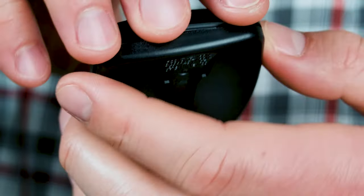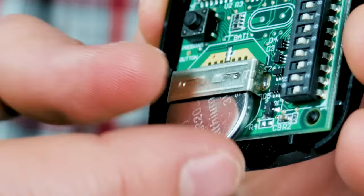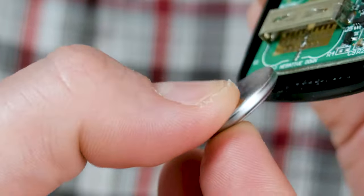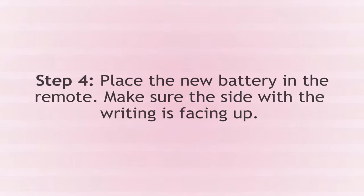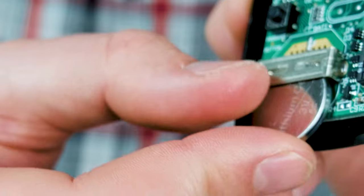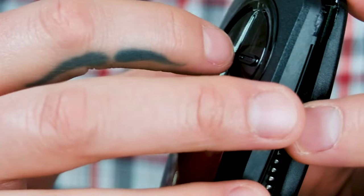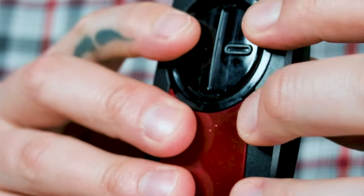Give the remote a little pull — it should come right apart. Set the front aside and now you should see your battery. Go ahead and remove it using your finger, or a non-metallic object like a pen cap. Push it towards the bottom — it should take a couple nudges but it should come out. Set the old battery aside and properly dispose of it later. Take your new battery — the writing and plus sign indicate the positive side, so you'll want the writing facing up — and slide it right in. Place the front cover back on the unit, line the edges up, and give it a little pressure. It should snap right back into place.